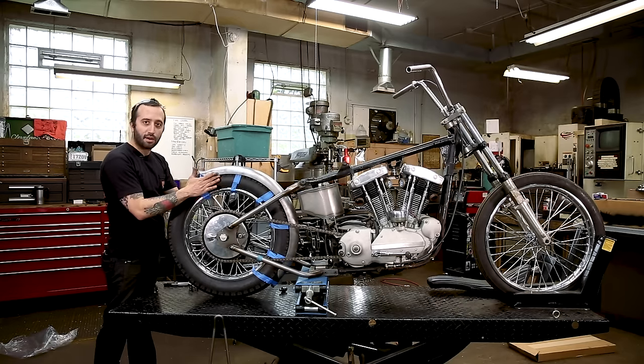To do this, I'm going to be using silicone bronze, which is available at any of the weld shops. It welds a little bit differently than any steel rod. This essentially works kind of like solder. It will melt before the base materials melt, so it's almost like you're kind of gluing this together and not actually melting all the materials so they become one. You melt this and it flows between the two materials. It only needs to hold the washers to the material while this thing's getting painted and stuff, and not really anything structural. This is more than enough to bolt it on. I use this in a lot of applications such as this. You just have to warm up the two materials and then you can just dab it right on top. And it works really great for stuff like this.